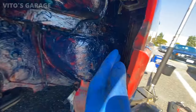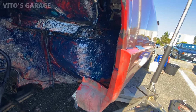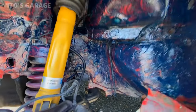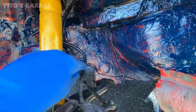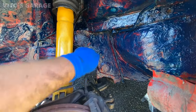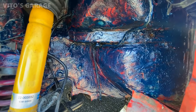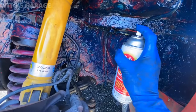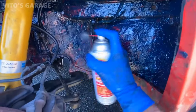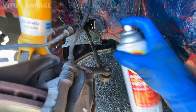These fenders will be getting replaced in the future so I'm not worried about them, but for you guys I recommend also covering the back of the fender — you can use fluid film for that. Fenders like to rust from the inside because of leaves, debris, and moisture sitting in there. Another thing to remember: if you get any grease on rubber components like rubber hoses, make sure you wipe that off. Wheel bearing grease is not really good for rubber. If you want to preserve your rubber, use silicone paste — but metal lines you can coat no problem.